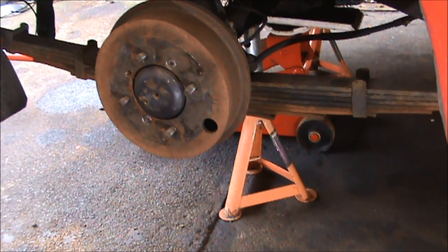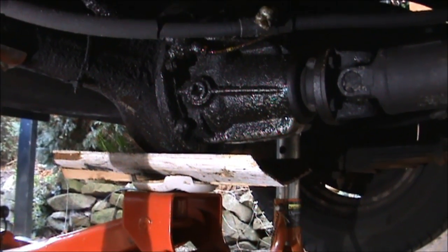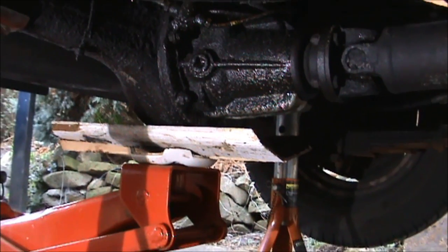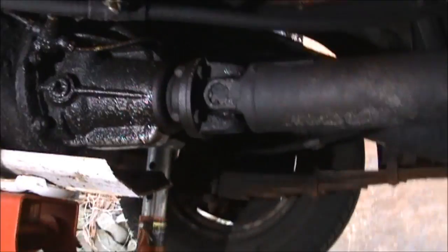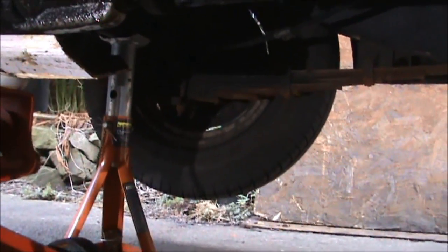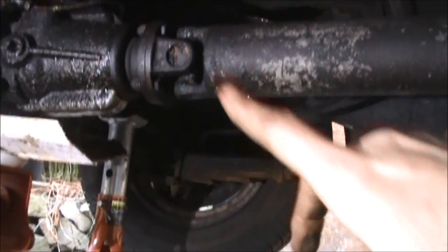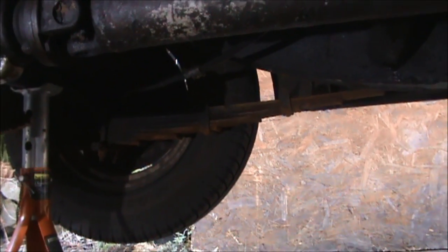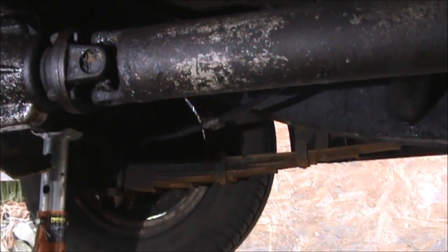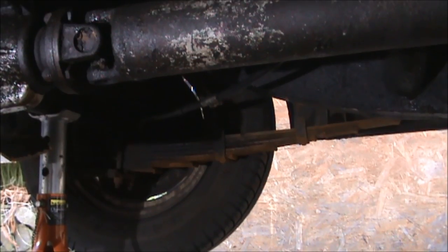I'll also have a quick look around with the light inside the wheel arches to see if there's anything that needs repairing coming up in the future. We've got one of two last little jobs to do underneath here, which are greasing-up jobs. One of the main ones is to grease up the prop shaft — you can see we've got a grease nipple here, just at the top there. We've also got some on the handbrake cables, one this side and one the other. The prop shaft should have a corresponding grease nipple at the far end. Like before with the front suspension, give it a quick clean, pump some grease in, and that job is then done.